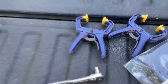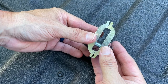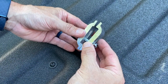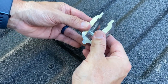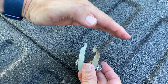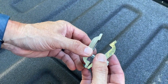One thing about these clamps: there are two different configurations. In the standard configuration the clamp goes lower on the bar. If you need to go higher on the bar, you reverse one of the sides to get a bigger clamping area further up. The idea is if you're clamping in the low position and the bar is coming down too much — not level — you clamp higher up to bring it up. You'll need to experiment with your specific truck bed to find what works.